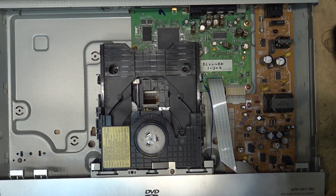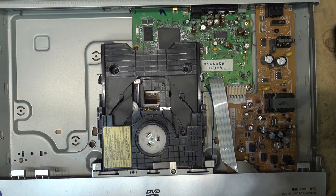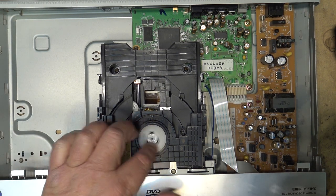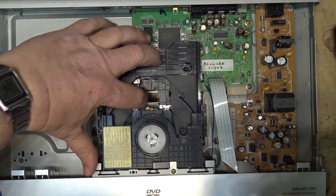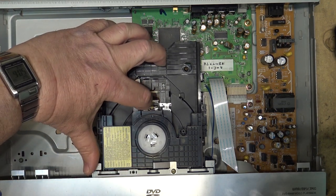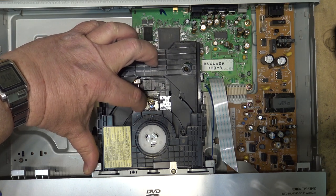As you can see the box is mostly empty. The power supply looks to be good — I don't see any bulging caps or anything on this unit. The problem is probably going to be the optical pickup, or more than likely the motor that spins it. Let's take a look at the optical pickup on this unit.